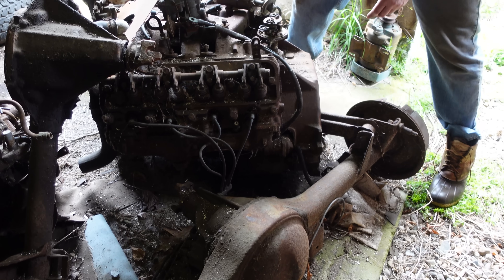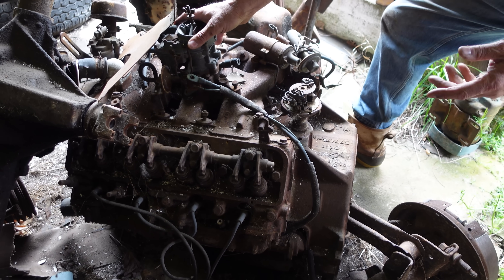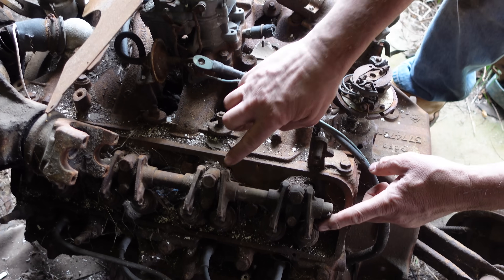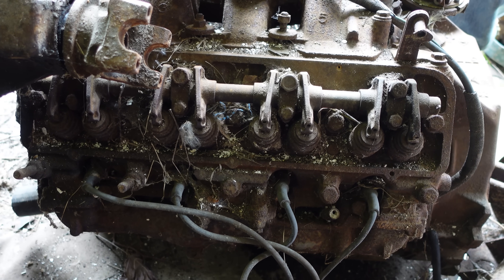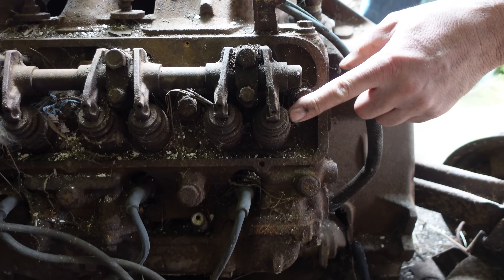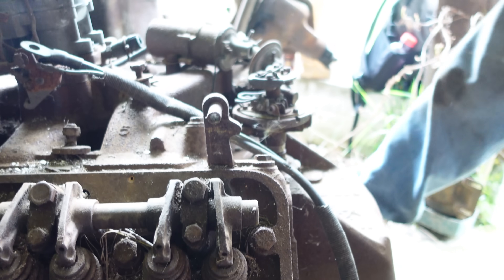Here is an Oldsmobile V8 — pre-1954, with the extended bell housing. It's a two-barrel car, just a basic one. Here are the rocker arms and push rods that made the Olds overhead valve V8 engine of 1949 one of the leading engines — this and the Cadillac of 1949 were the same basic design. And look at these beehive valve springs. A lot of guys think the LS1 was the first to use them — nope. They had them in the early 1950s Oldsmobile V8.